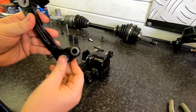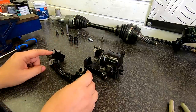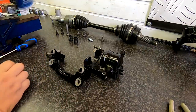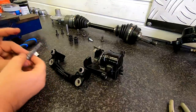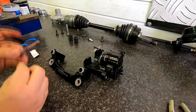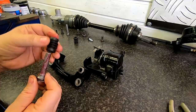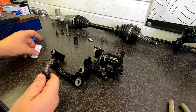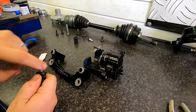I've now got the sliding part of the bracket for the caliper and I'm going to lubricate this — I'll use the red rubber grease again. I've still got some old stuff on these pins so I'll just put a bit of this on there as well, just to ensure they slide fine. They're going to go in there with one of our seals — are they both the same? Yeah. So I can put that over there — that sits over that groove there. It'll help to put a bit of rubber grease just around the top there, because it is a rubber seal — dust cover rather.